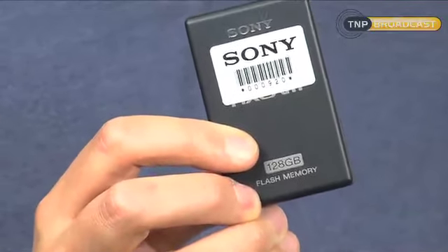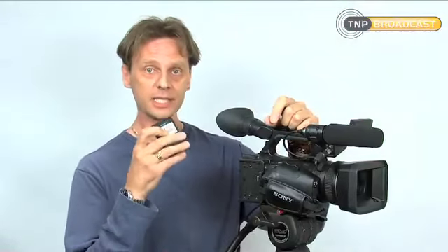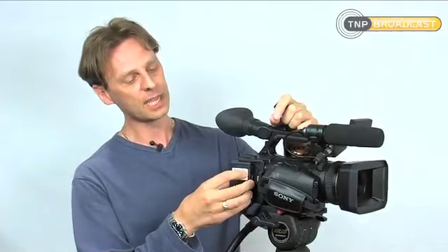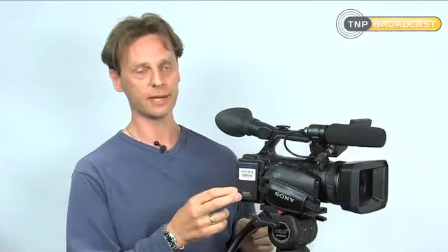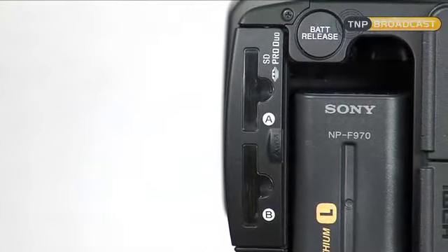While I'm talking about the flash drive, the unique thing about it is it's not a spinning hard drive — it is in fact flash, and there's no cable, no firewire cable between the device and the camera, so reliability is going to be really good. On the back you've got two card slots for SDHC cards and one 32 gigabyte card will give you 170 minutes recording time in maximum quality, whereas the flash drive on the side will give you approximately 11 hours in maximum quality.